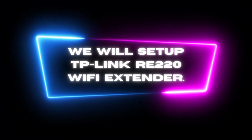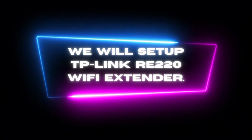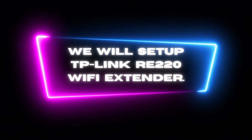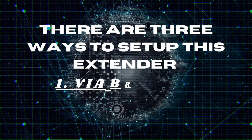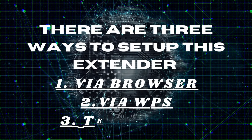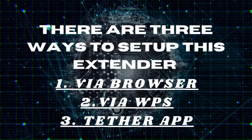And today we will set up TP-Link RE220 Wi-Fi extender. There are three ways to set up this extender. First, it is via browser. Second is via WPS. And third is via Tether app. So let us start with browser setup.